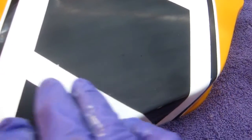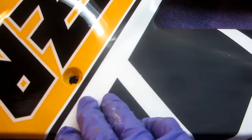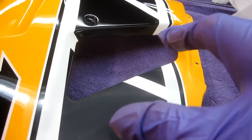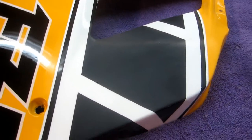Now I showed the sand out in real time at this part, but you can see there's a moon. Let me see if I can get it, there's the moon craters. And we have our little moon crater nail file that we wrap around 2500 grit sandpaper. One by one I will sand these out. And you'd think, see, now here's the mistake to make. You think, oh, nobody will see that. If you skip this step, yeah, maybe nobody will see it, but all that means is you hang around with a lot of blind people. The people I hang around with, they're going to see that right away. So I'll spend the rest of this time, even if the only thing I get done today is a part of the sand out, I'd rather have a part of it done right than have the whole thing done and be ready to buff it tomorrow, and it's not perfect.